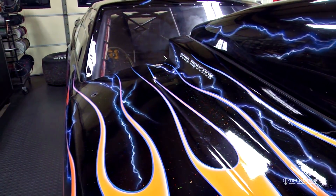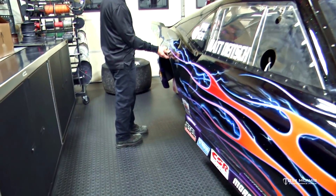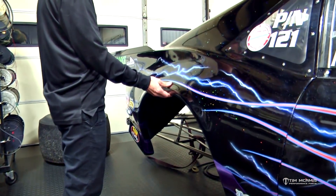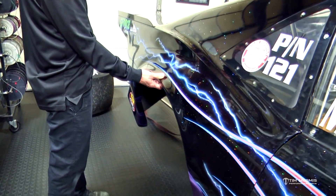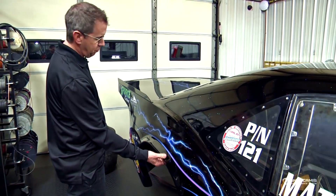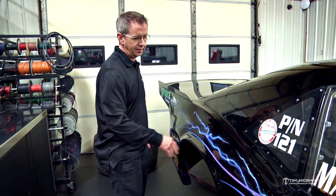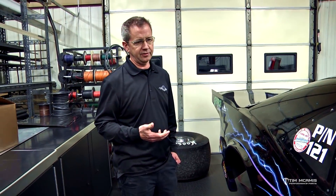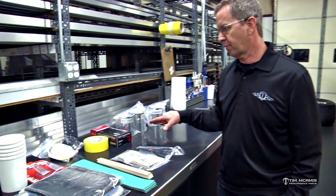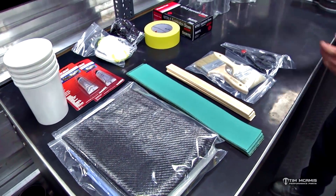There's a little crack around the hood opening here. Areas like the front of the doors where the hinges are, the back of the doors where the latches are, and especially around the rear wheel opening get beaten up because you're taking the tires on and off a lot during the year for four-link settings. Before that gets too bad you should do a repair — it's really easy, and a lot of people are intimidated but we put together a kit that's easy to use at the track for spot repairs.